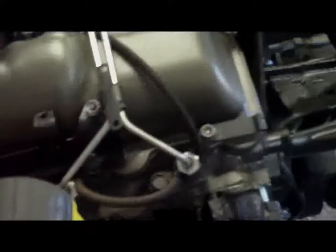3 inches would bring this forward. Let's go grab a tape measure because I'm not prepared. 3 inches at the firewall here would pretty much clear everything from the back of the engine up to that glow plug. And if we look at it right here like that, it looks like there would be no possibility of any interference, because it'll actually be sitting forward of the firewall. I imagine the same is true on this side, because this side wasn't quite as bad for clearance. Let's just measure this, have a quick look here, and it looks like it's the same story here. So there you go. Move the engine 3 inches forward of the stock small block location, and it looks like it'll work quite well.